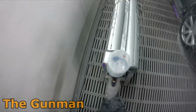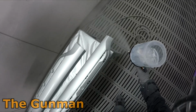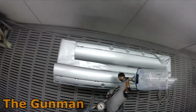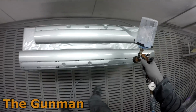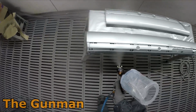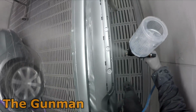So as you probably noticed up the front there, where I did have that little bit of a spot repair on the front bumper, I just put a little bit of fade out thinner over the edge of the clear coat. That'll get buffed in, or it did get buffed in the following day. And my detailing man out the back gave it a polish for me as I was spraying the next job. So all's well that ends well.